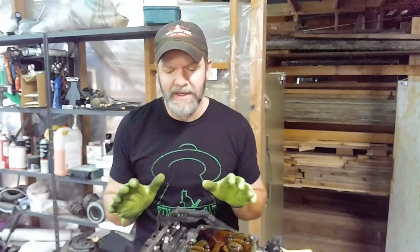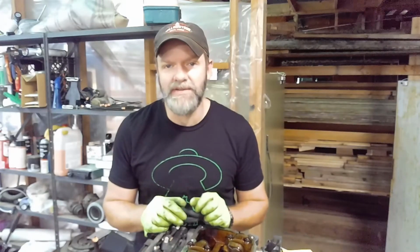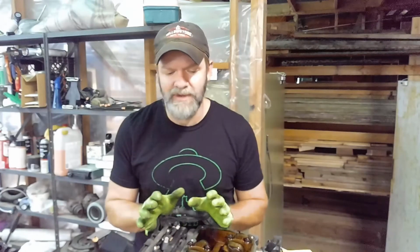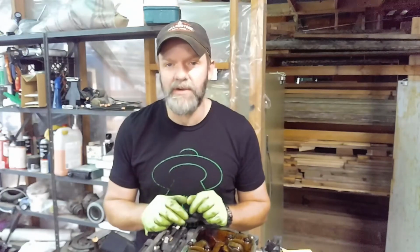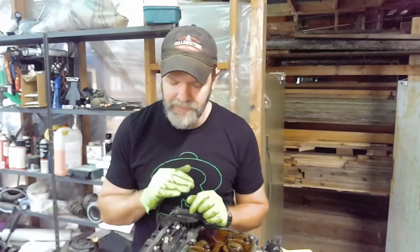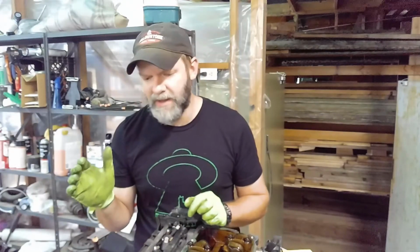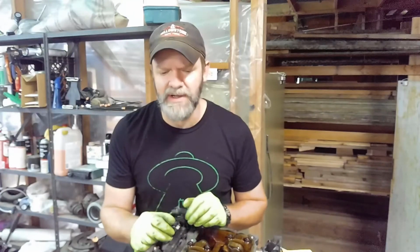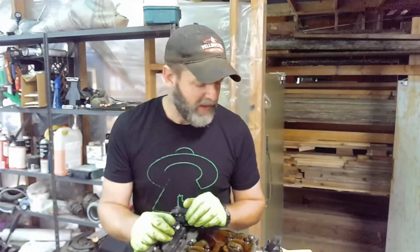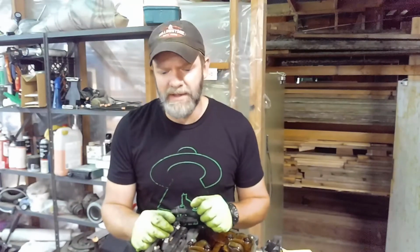All right, everybody. I think that's it for today. Checked what I can check on this motor, and it seems like basically it's healthy, so that's good. Now that I know that, I'll go ahead and start ordering some parts for it. I'll do new plugs. I'm going to redo the timing chain and guides. I'm going to do a water pump. I noticed maybe some leaking at the rear main seal, so when I have the clutch apart, I'll investigate that a little more. And then some cleanup, and this one will be ready to put in.